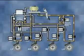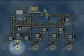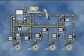The ABS computer continually monitors the wheel speed signals. If a difference in wheel speed is detected as the brakes are applied, the computer will activate the modulator solenoids so that fluid pressure can be adjusted as required to the appropriate wheel or wheels.